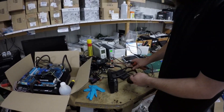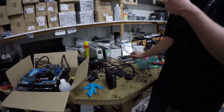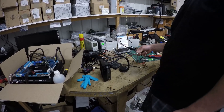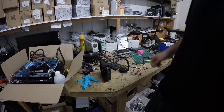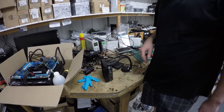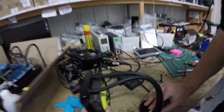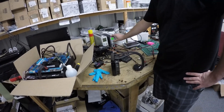This is a quick video to show how to repair one of these all-in-one coolers. I've got it hooked up to a 12-volt power supply — you could also hotwire your PC power supply to run it outside the PC. If I switch this on now, you can hear this thing buzzing away because it's got air bubbles in it, and if I shake it you can hear them in there.